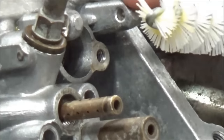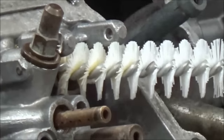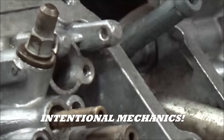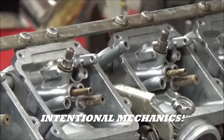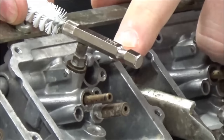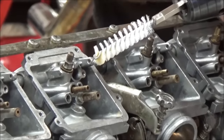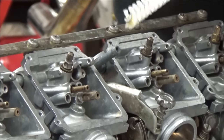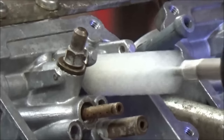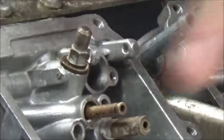There is something to use caution on — do you see the metal tip on the bottom of the brush? If you hit the side of the carburetor wall with that you're going to cause problems. Be really intentional about what you're doing. Also check your tool for wobble; this one has a little, so I'm going to put it on a clutch setting and not be super aggressive the first time. A little PB Blaster, and now let's check our work.